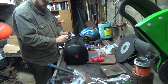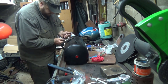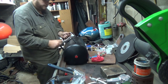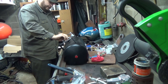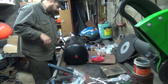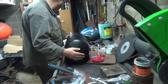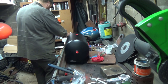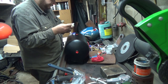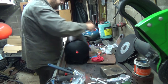Okay, that's probably pretty good. Just want to give her another little crank there, so there, that's pretty good. Okay, so that is technically two positions that could leak, so that sucks. So on the top now they're saying for the pressure switch, or not the pressure switch, the safety valve. Sorry, I was looking at the wrong fitting there. So there's the safety valve. It's already got some red stuff on it, looks like red Loctite or something, but we also got to put another one of these in. Another potential two leaky spots. But that's okay. Teflon the crap out of them.